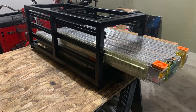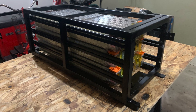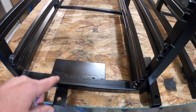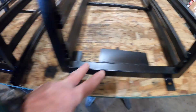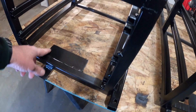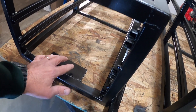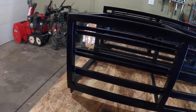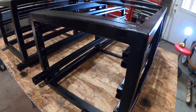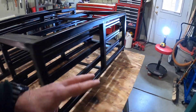They slide in like a drawer — slide in and out. Put one in, put the second one in, put the third one in, and that completes the pack. I also welded a plate here — this is going to be a mounting plate for the fuse. There's a high voltage fuse that's going to go into each of the packs, taking the positive into the fuse, positive out, and then through my Quick Connects into the main system. After I slide the batteries in, I'll bolt the fuse holder down onto that plate. Turned out really nice — one inch tubular steel, and then these are half inch to create the drawer slides.